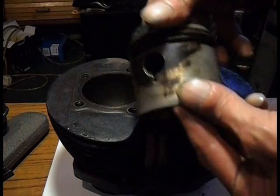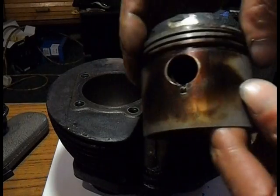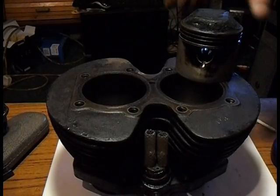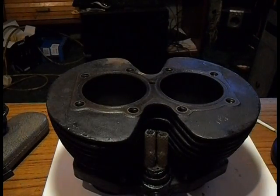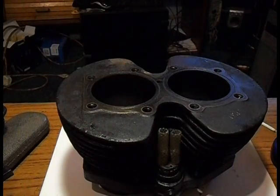That one isn't too bad, this piston. It's not too black. Obviously, that one, black death. Look at that, that's gas and bypass past the rings and everything, just shows the way. Just probably in the light. That's as much seal as they're giving me. Straight in. Obviously there's no rings on. So, yep. Another small demonstration. Straight in. Right, so that's the state of my bores.